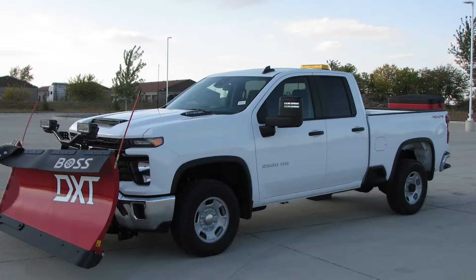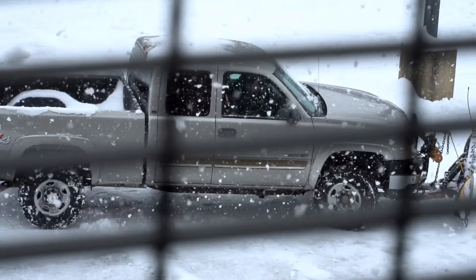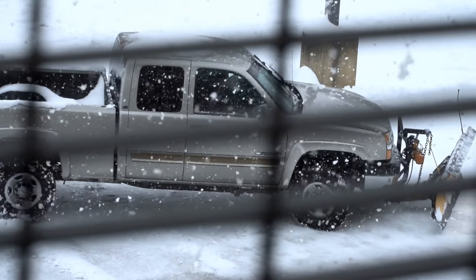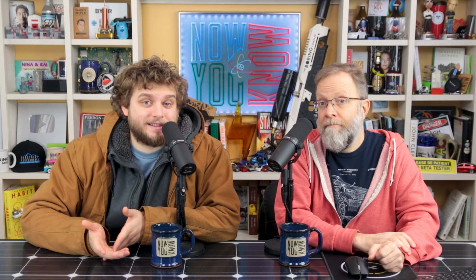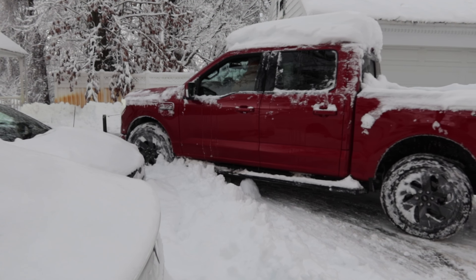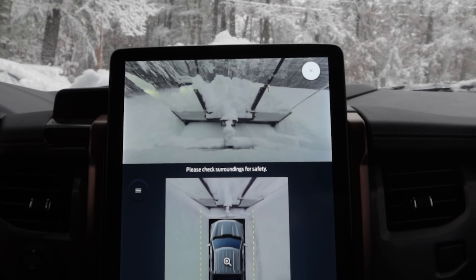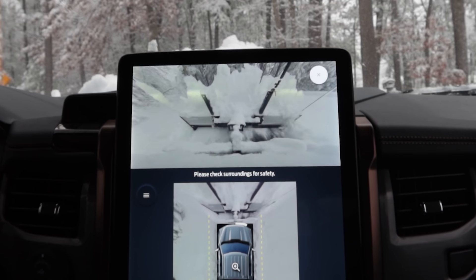I'm not a snow plowing expert, but I have gone out plowing with a buddy a couple of times before, and one thing that stands out: in an ICE truck — his was a Chevy 2500 heavy duty — you have to get up a head of steam when you're trying to move any significant amount of snow. You have to take into account your momentum and develop a good feel for how far your truck is going to travel before coming to a stop. Not far enough and you have to back up and re-plow; too far and you're going to crash into a garage. However, with the Ford Lightning, you can go as slow as you want, and because of all the torque being available even at extremely slow speeds, you can creep along and carefully get that snow exactly where you want it.